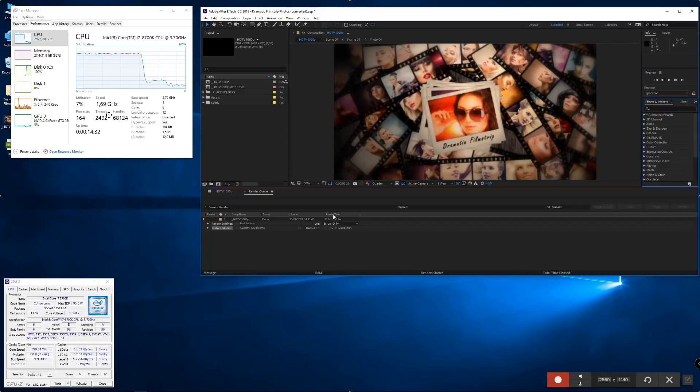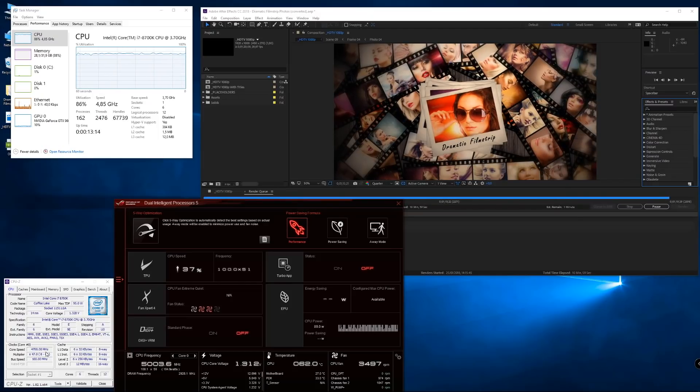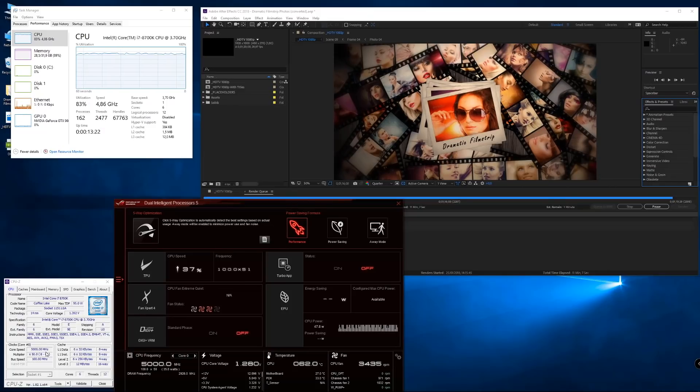Getting to the overclock part, it's not a problem with the CPU cooler — I'm getting 60 to 70 degrees Celsius, and with a more aggressive cooler profile I can hold 60 degrees. The problem is the silicon lottery. I was unlucky; some people reach 5.1 or 5.2GHz, but not much more than that stably. In real-world terms, we save 30 seconds per 12 minutes of rendering.